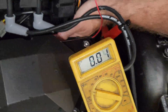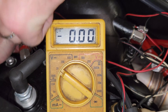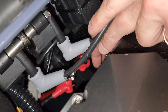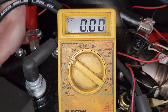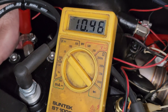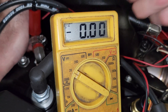When the probe is on the starter terminal, we're going to have nothing right now until I hit the starter button. I've got my lead on the starter side of the solenoid. I'm going to hit the starter button and you're going to see voltage go through this thing. We're over ten and a half volts — that's good. If you fall below ten and a half volts, that's bad.